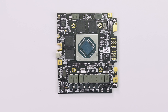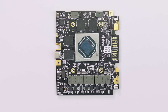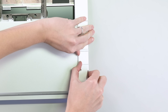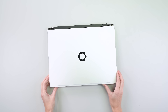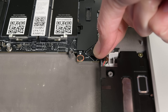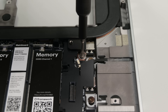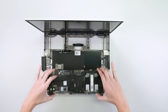The board itself is rather unassuming, but represents a shining future of upgradable graphics for gamers everywhere. With the upgradable peripherals removed, what's left for the mainboard? Let's pop our expansion modules back out — easier said than done, these guys are snapped in tight, which is good news for portability. First we'll disconnect and remove the biometric button and frame, then the speakers. Now we can tackle the logically numbered mainboard screws — for a change, these aren't captive, but nor are they gold colored. Bye-bye display and camera connectors, and hello mainboard.